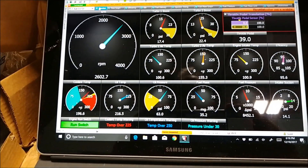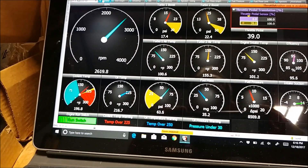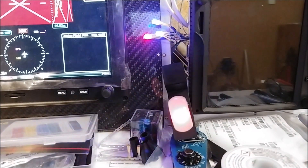I'll show you the fix for that in a bit, but it looks like using the fuel in the aircraft's tanks to cool the engine is actually going to work out really well. Back to the wiring — I've hooked up all the gear indication LEDs. Up top there are three LEDs for the nose gear and the two main gear, left and right. Down at the bottom is the gear lever switch, which also lights up. I'm connecting and disconnecting the magnetic switches that will indicate whether the gear is locked up or locked down.